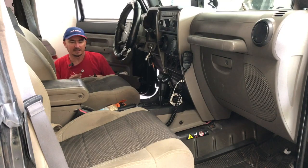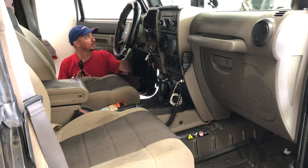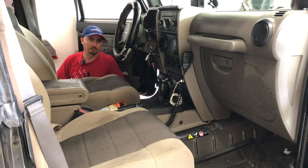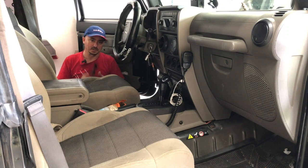I've got the antenna disconnected from the 857 that's under the driver's seat. It runs back up through here to a penetration point in the firewall and is also run underneath the plastic trim. I'm going to pop that plastic trim piece up and get this fed over to the other side of the Jeep where we can tie it into the 400.